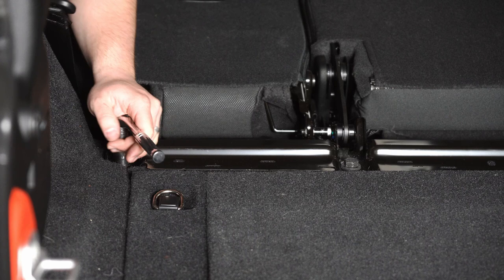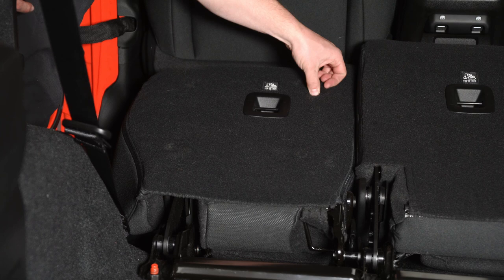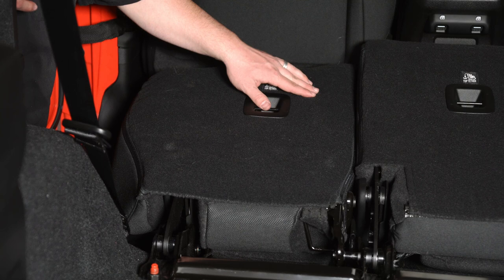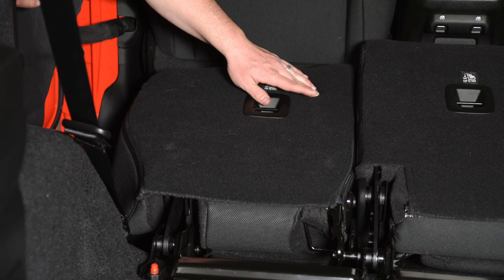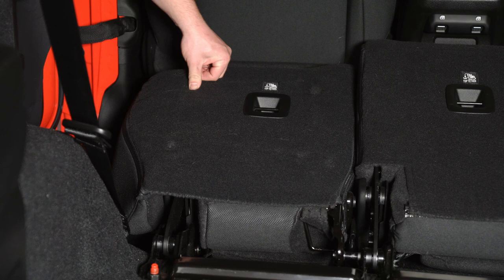Now we can move on to cutting into the back of our seat. This is going to be one of the most difficult parts of the installation — and honestly it's not difficult, it's just that I don't like cutting into fabric and making a permanent modification. But it's going to be well worth it once you're done, so don't be too scared of it. You need to cut a couple of circles out so you can attach the grommets that will clip in the rubber mat. On the 40 side, the driver side, you're going to have four spots. The way I feel for them is just run your hand and give it a solid push — you can actually feel the circle underneath. There's one there, one right here about six inches from the bottom, another one horizontally over, and then one a little bit up and to the left.